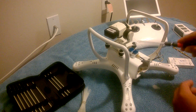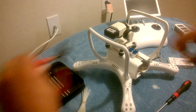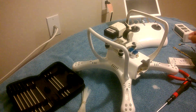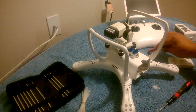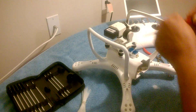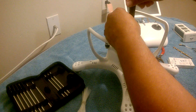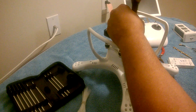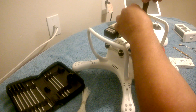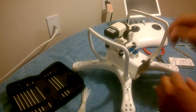Let's grab the drone. You'll have two screws on both sides. First I want to take off this antenna. On your Upair One you're not going to have this unless you've already upgraded it, and you're not going to have these blue heat sinks — you can add those yourself, I'll put the link in the description below. Now remove these screws — two screws, put them aside.